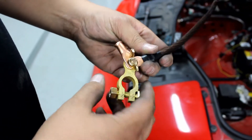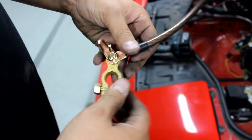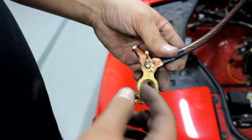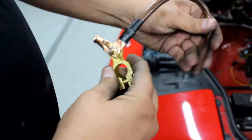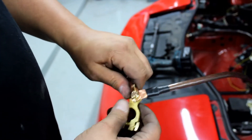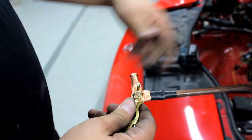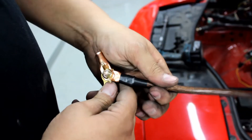So this is more or less what it's going to look like. This is the positive terminal one, but I've got to go buy a negative one because the posts are different sizes — if you didn't know, now you know. So this is going to go to the factory spot, that's why this one's short. This longer one is going to go to the opposite side of the car to give it another grounding point directly to the battery.